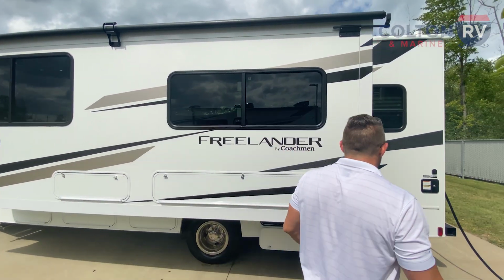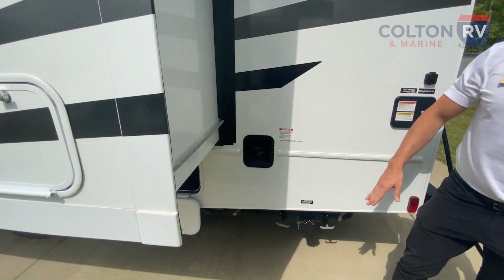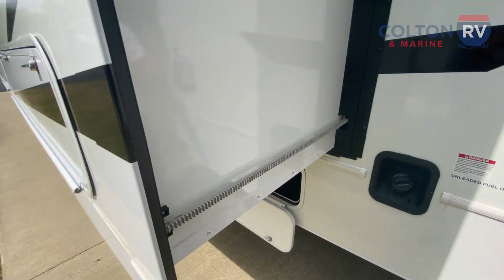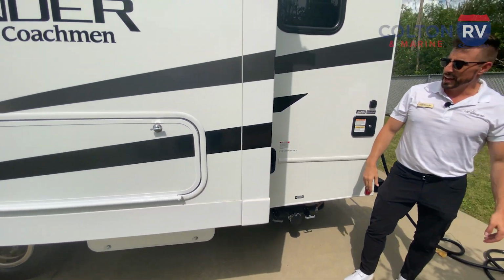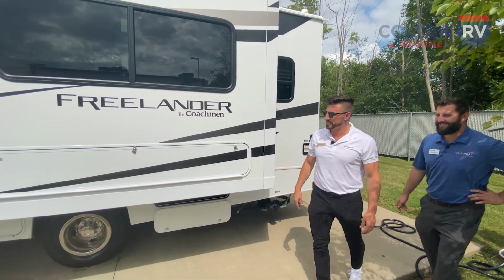The slide mechanisms that we're using are these Slim Rail slide systems. It's an electric motor on each side. You can run those in and out. They self-synchronize. Just make sure you've got plenty of power before you run those out. Don't run them out on low batteries.